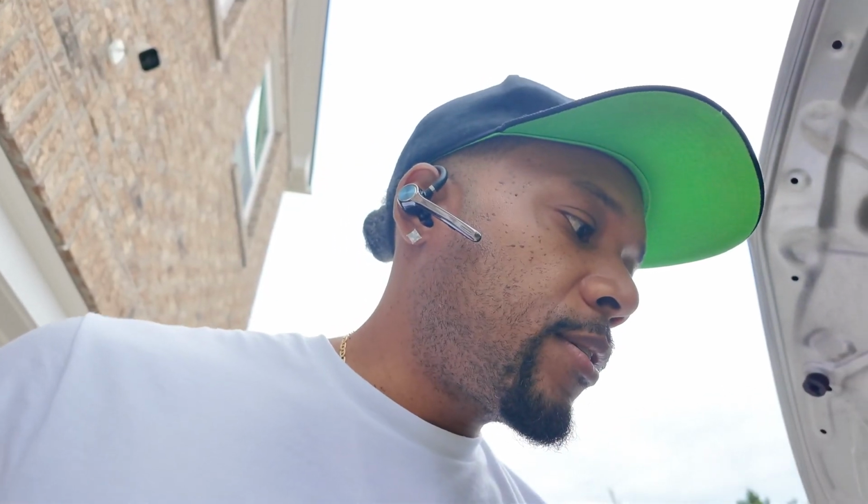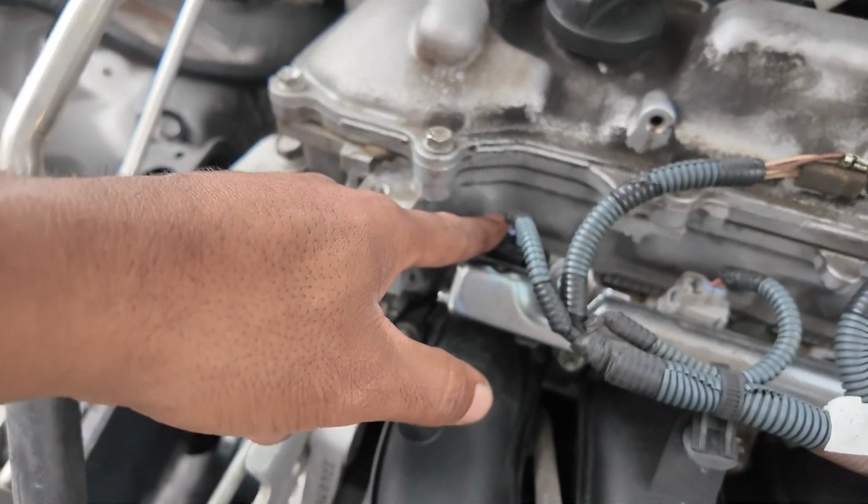So I pretty much thought it was the plugs, thought it was the coil, did a check on it, and swapped out the plugs. The problem was still there. So I was thinking maybe it's the injector. I noticed whenever we got the misfire, the injector stopped working. The injector is right here. I noticed there was no pulse to the injector whenever it started doing it.